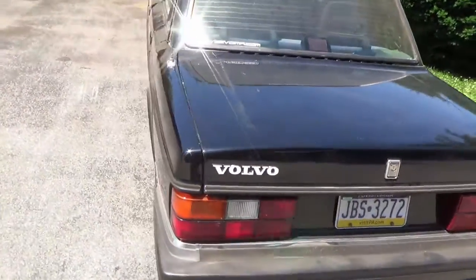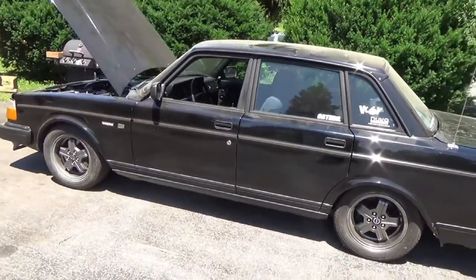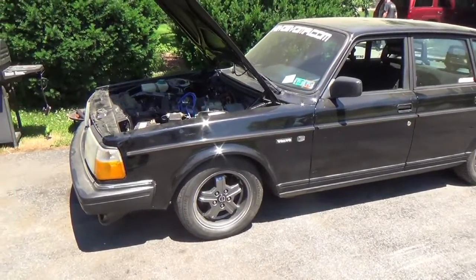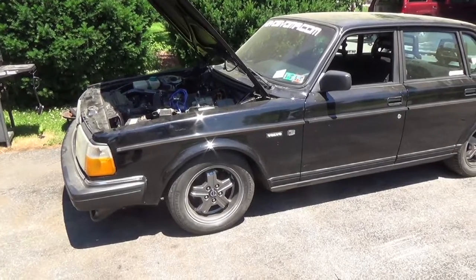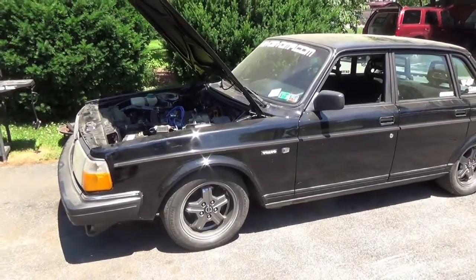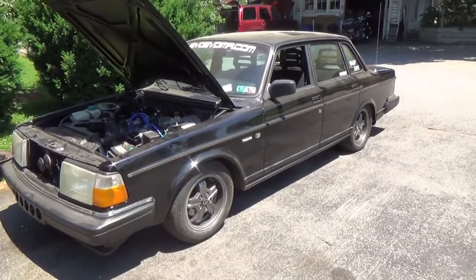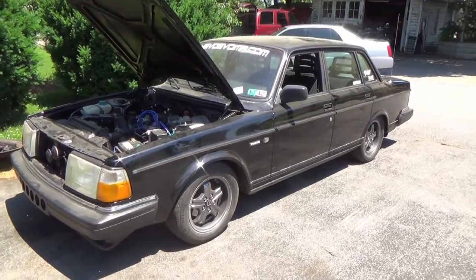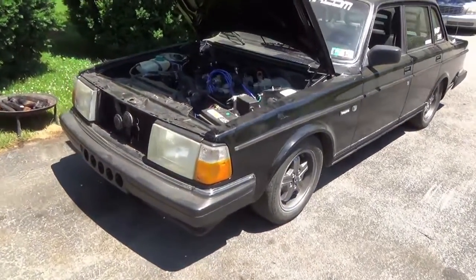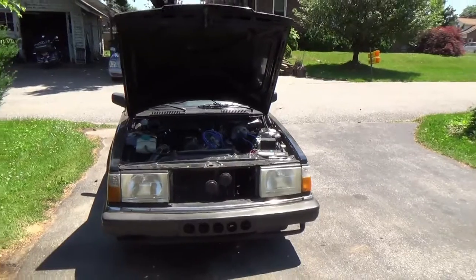Today is going to be mostly getting the original engine and transmission out, and I think really the biggest hurdle is going to be getting the other motor in with the Turbo 350. I think that's going to be the biggest challenge, and it might not be that bad, just getting the custom mount situation taken care of for the transmission. Also I'm going to have to do something a little bit funky with the drive shaft, although it looks to me like it may only need to be cut about 1/2 inch, so we'll see. We'll keep you posted.